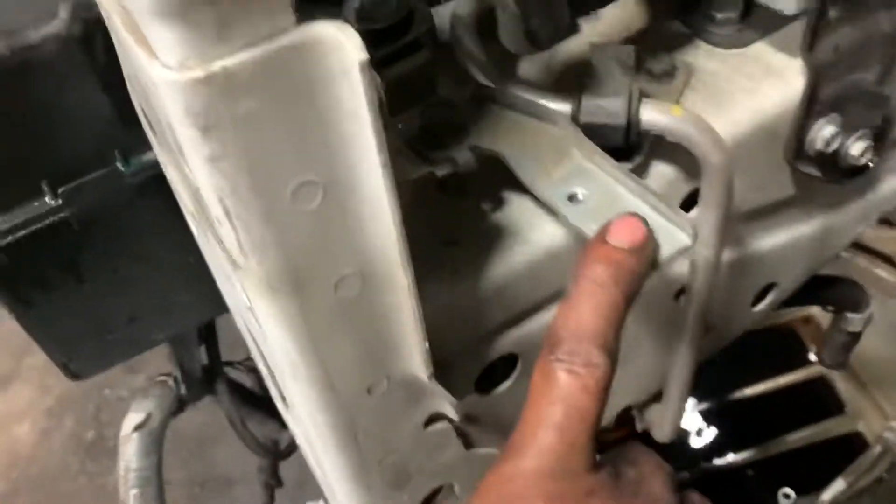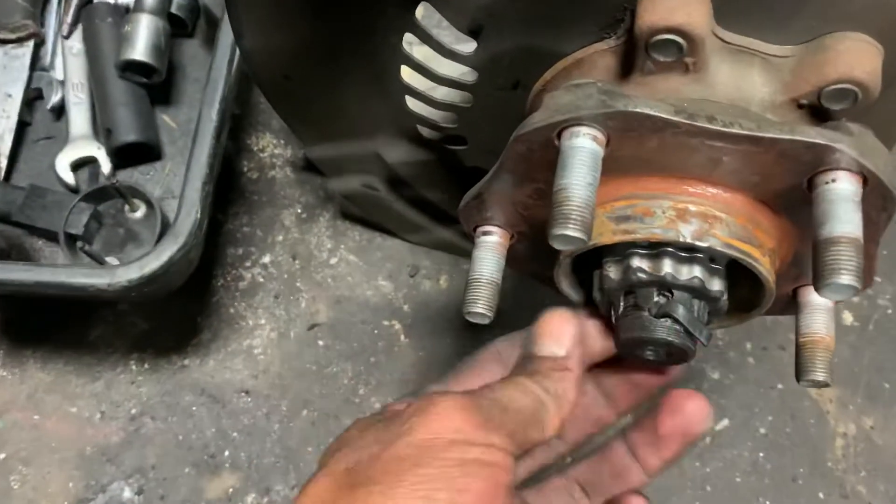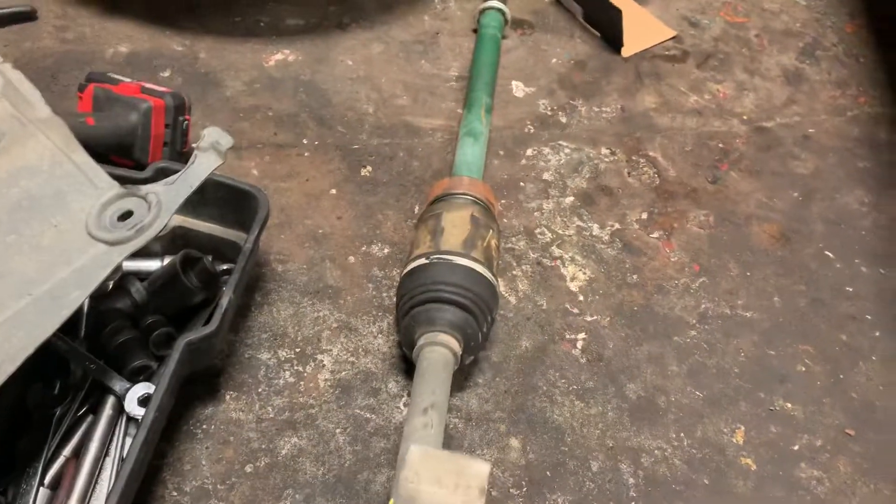You can see it's broke loose. It's got two 10 millimeter bolts right here that hold it down, so you got to take that loose in order for the frame to come down. On this side right here, you do have to take the axle out. I don't just take the axle — I take the whole spindle out, and it's easy for me. I think it's easier; saves you some work. You don't have to mess with this nut — somebody put thread locking right here, so you mess up the nut, you're screwed. You'd have to replace the whole axle.